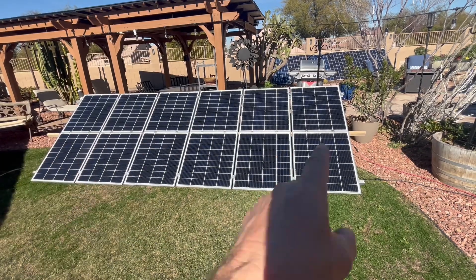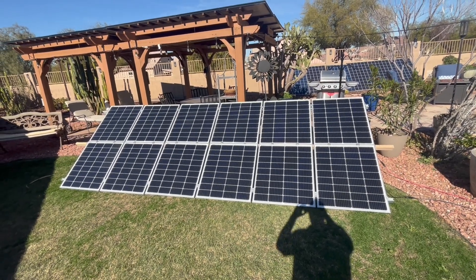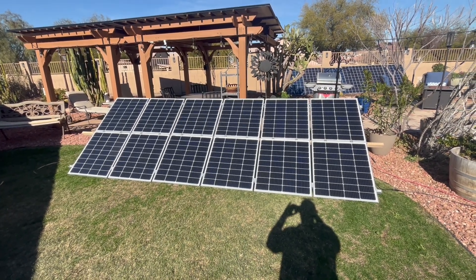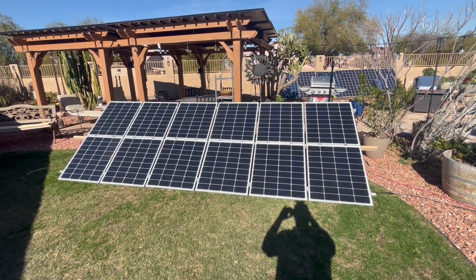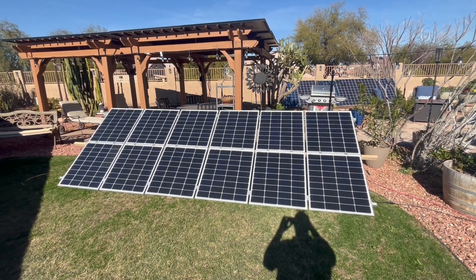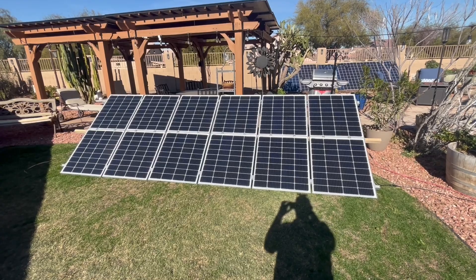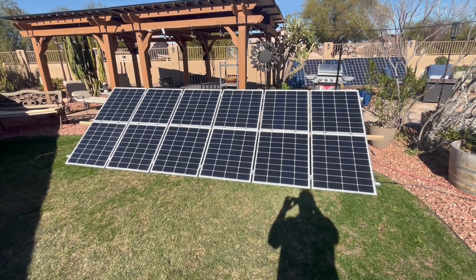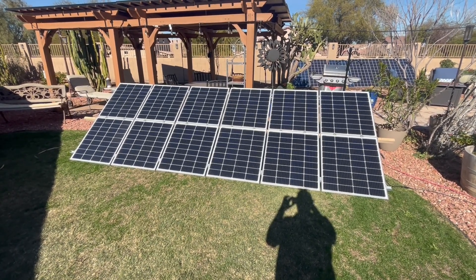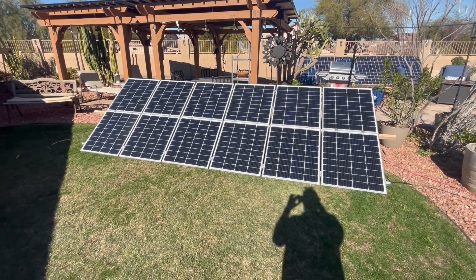The way this is set up, it would actually fit up on top of the roof, but I haven't seen any mounting hardware that I like yet. I'd actually like to use aluminum mounting hardware where I could mount it at the top but on the side, so I'm not putting holes in the roof — mounting it through the side walls instead. I think I'd get fewer water leaking problems over time doing it that way. If anybody has any ideas or product suggestions, please shoot me a comment.